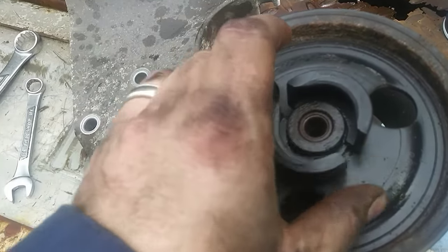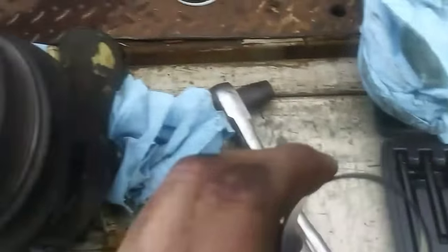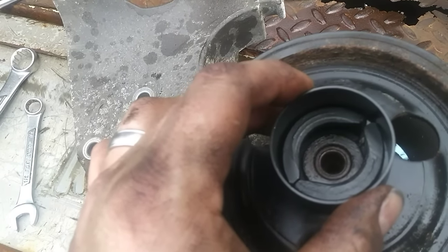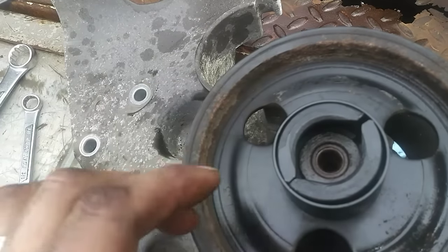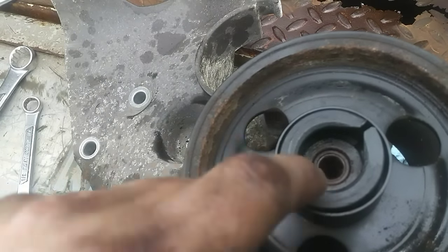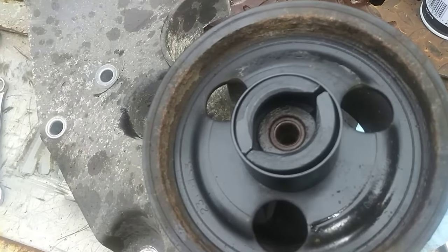The way this works is it just clasps the side of this ring. Then there's another ring that goes on the outside that holds all of these together. Before you put that on you have to put on the other tool. Basically there's another tool that grabs the top part of the ring, and then you shove a bolt down through the center and that pulls the pulley off. It's pretty simple.